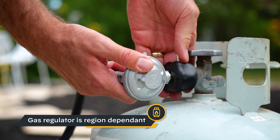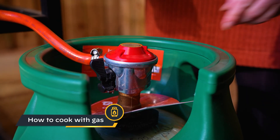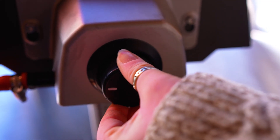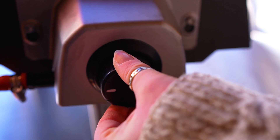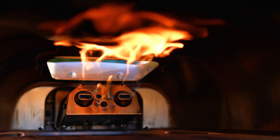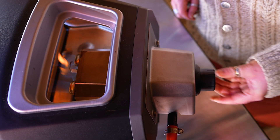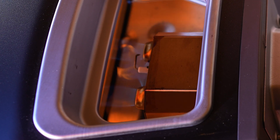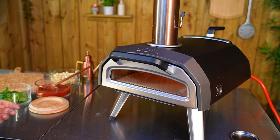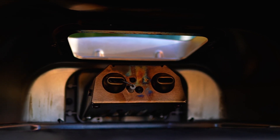The gas connector might vary depending on where you live. To light your gas burner, turn on the gas at your gas bottle, then push in and slowly turn the temperature dial anti-clockwise for five seconds until it clicks. It's important to keep the dial pressed in for five seconds after ignition to override the flame safety device — otherwise your oven might not stay lit. If you see a flame through the fuel hatch door, that's perfect! Put the hatch cover on, close the door and wait for your oven to preheat. If you don't see a flame, turn off the gas, wait five minutes and repeat the lighting process.